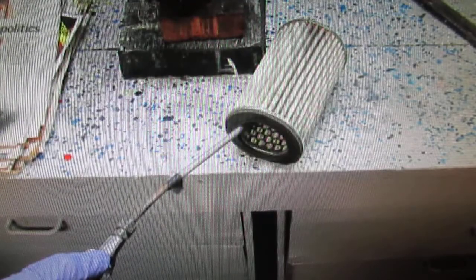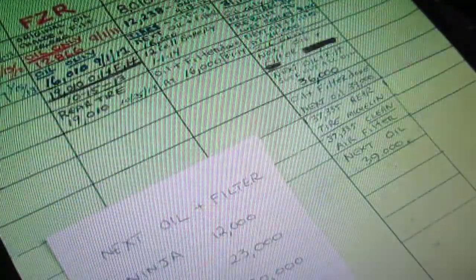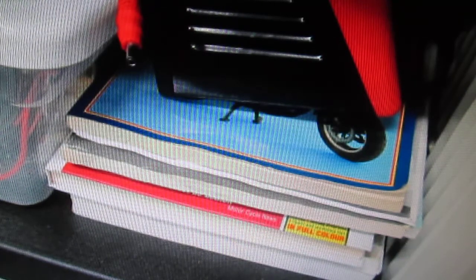What's important is to clean the air filter with air from the inside to the outside - you don't want to blow stuff further into the air filter. It really wasn't bad and it's got less than 10,000 miles, but I do need to pick up a couple more air filters. I always keep track of all the maintenance - I keep a log book, a pretty accurate one - noting the date when I change tires, when I change oil. The most important thing is I have the service manual for every bike I have, even the track bike.